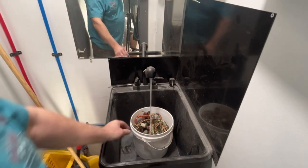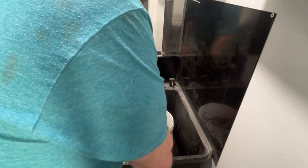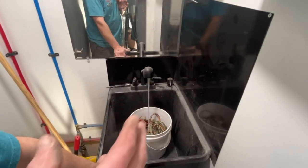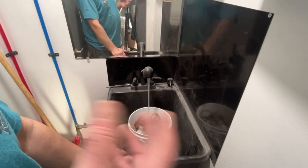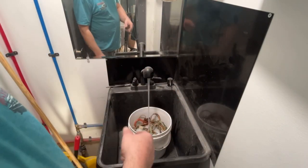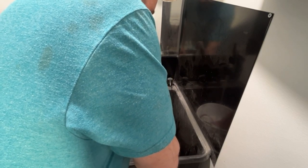Don't be afraid to do this — it's not going to hurt anything. The key is to make sure that you completely dry it out before you plug it back into the game. Don't do this in the morning and think you've got it dry enough to plug it in that night. Let it sit overnight, hang it up after you take it out of the water. After a couple hours of it hanging, flip it the other way so moisture can get out of the connectors.